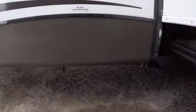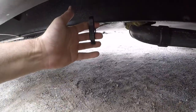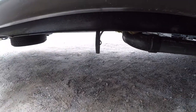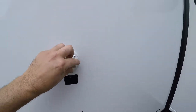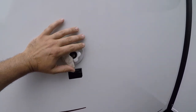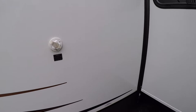Just in front of the slide you have your holding tank drain. You have your release here for the black water, which is your toilet. Farther back are the two grey water ones, which are for your sink and shower. Up here is a hose connection — this is a tank flush. When you're draining your system, you have your sewage hose connected, valves open, you hook a hose onto this, and it'll help flush through everything and clean out the system a little better.